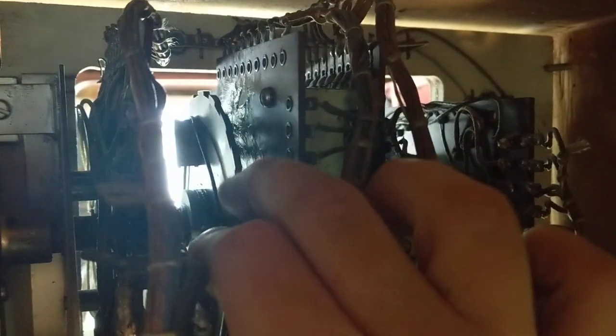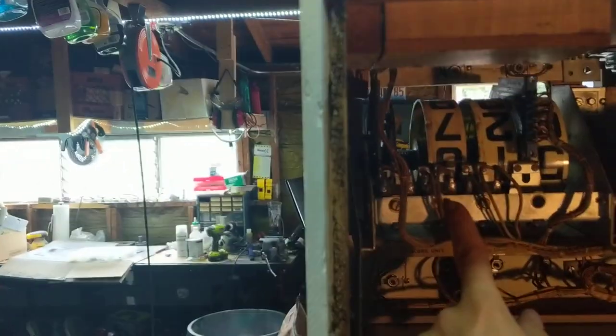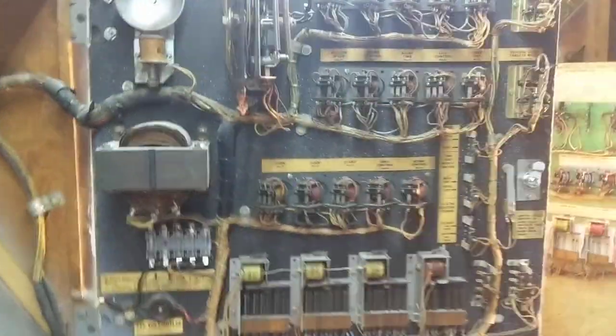The other thing you've got to do is clean these contacts in here. You can see there's a wiper arm, and it makes contact with those different little circle contacts as it goes around. If it's really bad and nasty in there, you can pop this whole thing out — it's kind of a pain, you can unscrew the relays, and there are a couple connectors you'd need to unsolder or take the motor out. But what I did for three of these games is just get some Q-tips soaked in alcohol, get in there, and clean really well. Go through a bunch of Q-tips, then if you can, get some sandpaper and rough up those contacts a little bit, then re-lubricate with a dielectric lubricant. After that, I've had really good luck getting these games going — it's been pretty easy otherwise.